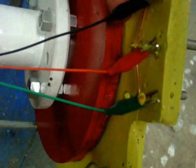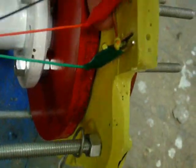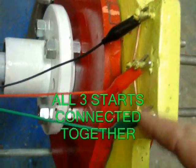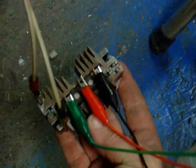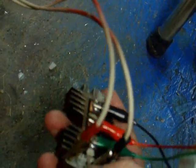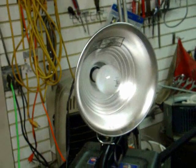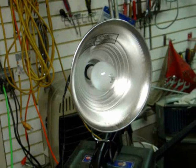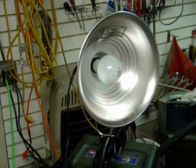I've got one wire running all the way across, taking all three of these starts and wiring them together. I've got L1, L2, and L3 — sorry, this isn't the right color codes — going to L1, L2, and L3 on the voltage rectifier. Then I have the negative on the one hump, which is the negative output, and the positive on the two humps. It looks like it's going to the battery, but I have it going to a 40-watt light bulb, which means the voltage has to hit 100 to 120 volts to get the right amperage. It's not a very good test, but I like to light the light bulb — it's kind of fun.